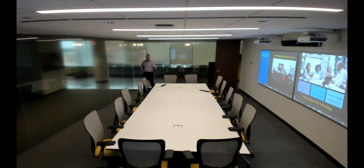Think about big group meetings or a classroom with lots of people talking - different speaker profiles, not just people with a loud voice. What if someone is a soft speaker in the corner or facing directly away from the unit? Standard audio challenges in this room include glass walls - 50% glass - a table that seats 16 in the middle that's highly reflective, and interactive surfaces on the wall. Most meetings also have a stand-sit option. People sit down and type, so we have active echo cancellation built in. I'm about 20 feet away, typing away - as I speak again, the HDL focuses on my voice without removing all background noise, because you want that remote listener to feel connected to the room. We call that the natural audio experience. This room also has HVAC, which we filter out.